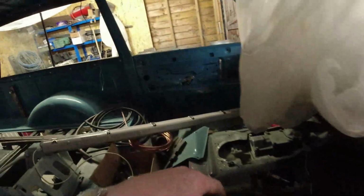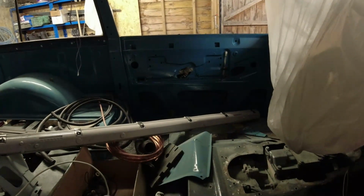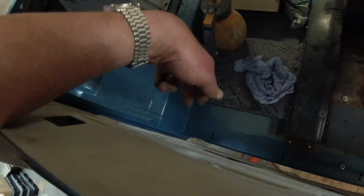So the other side I fiddled around with the shims a little bit, but then I hadn't had an opportunity to mess around with the door on that. Now, I still need to mess around a little bit with the door because it is bowing out a little bit in the middle edge here. So I need to adjust the frame so it comes this way, straighten things out. Now, I can do it largely with my knee, to be honest, but you can see there, it's touching the B post there and it's still too far off in the middle. So it still needs some work.